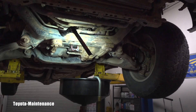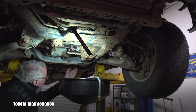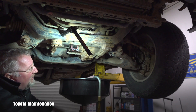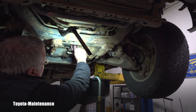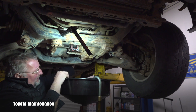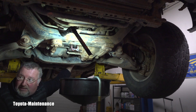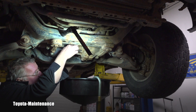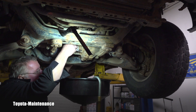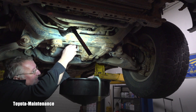If this clutch part is towards the passenger side, the transfer case shaft can be rotating but the wheels are not moving. Now let's pretend my finger is that fork - I will keep turning this and carefully go towards the driver side. Now I have a hard time turning this propeller shaft because I'm already moving this one also. If I want to disengage the front, I slowly move it towards the passenger side - the movement is within an inch.